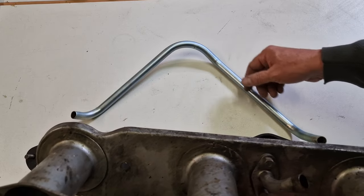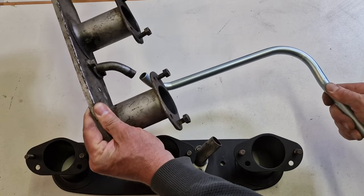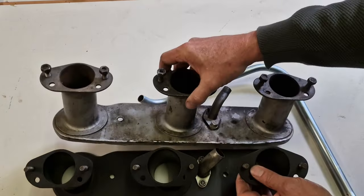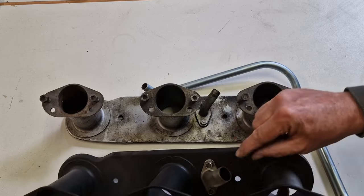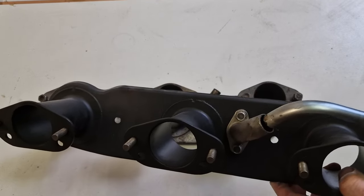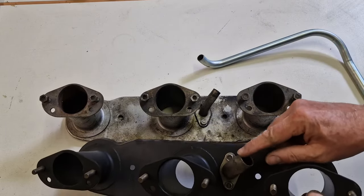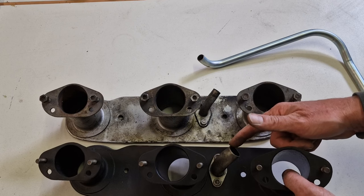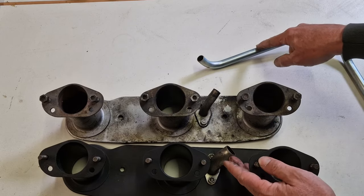and the balance pipe, and is coming out somewhere here at the engine, and it is mounted here. And you see that this one here is lots thinner, or smaller in diameter, than the later one, and the later ones also had this diameter, as you see. I can't get that in here, and that should not be the case. This is a 3/8, and this is a 4. Don't know exactly when they changed it from the small to the big one. Might be with the new carb system or with the new air intake, with a manifold, but this does not fit to this pipe and vice versa.